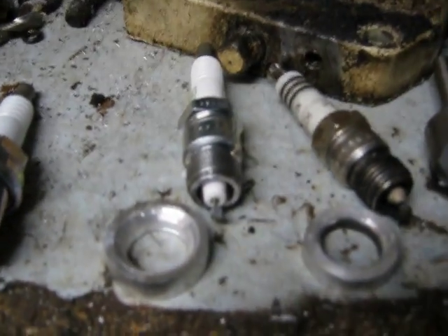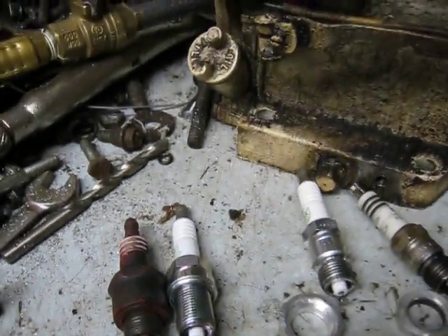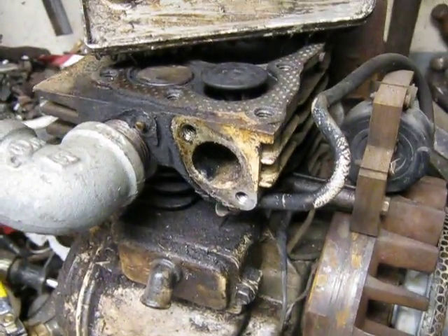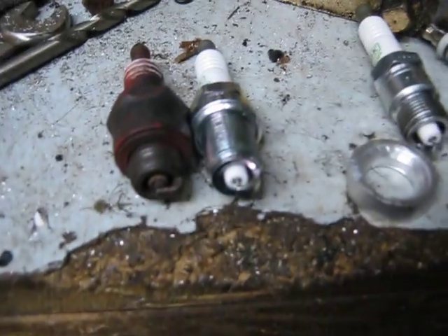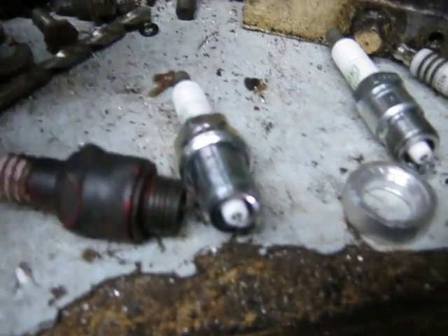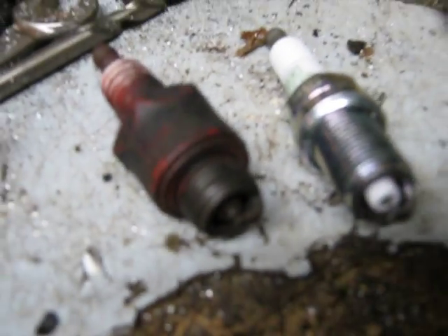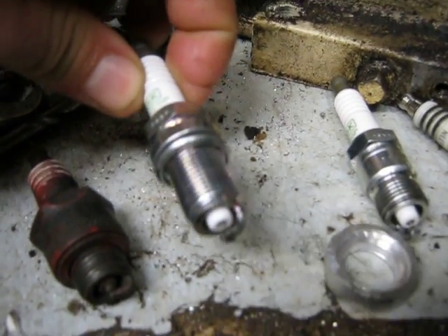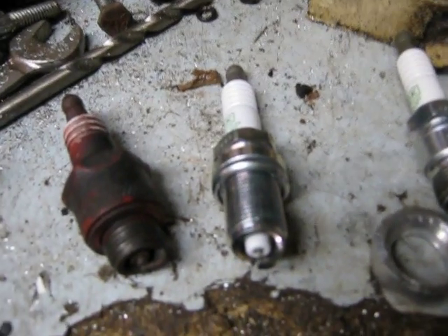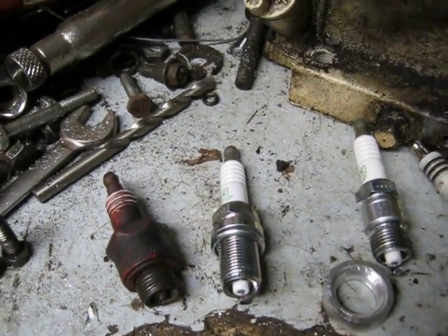Just having a little fun there. So the object here — I've got a 5-horse Briggs engine that's a bit of an oil burner and it likes to really foul the plug up. This isn't the plug out of it — it's just one I've used for painting — but it gives you an idea of what the regular spark plug looks like. And here's a fairly common platinum type spark plug. As you can see, it's got two and a half times as long a thread length, so that's going to cause us some grief.